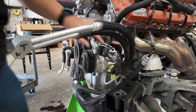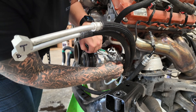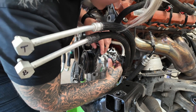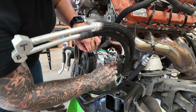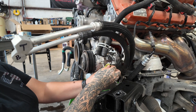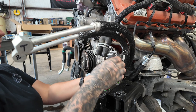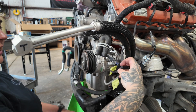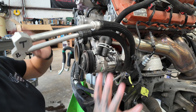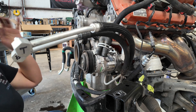Going back to the labeling principle — it's always good to label your wiring harnesses and connectors when you're disconnecting them, that way you don't forget where things go later. For instance, for the AC compressor right here we have a top and a bottom one, so I have 'AC top' and 'AC bottom' labeled. They are color-coded — one black, one gray — but it's always easier to just double-check by labeling everything.